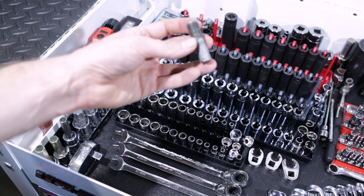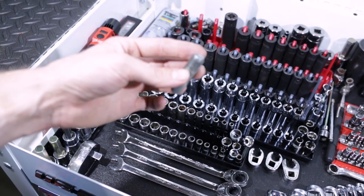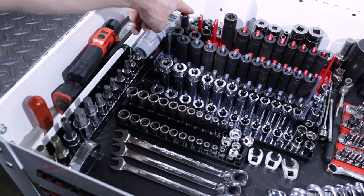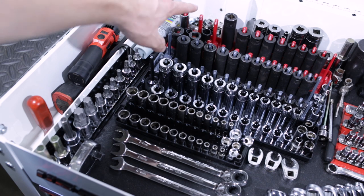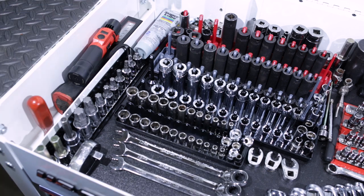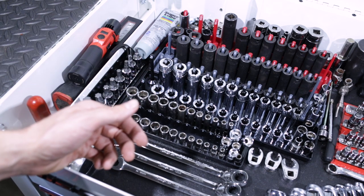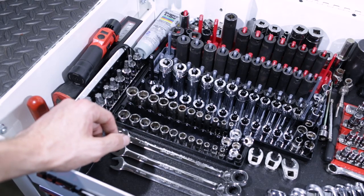Back here is a tool I made just the other day for installing wheels on a Mercedes Sprinter — just cut down a wheel bolt and put a slot in it so I can hang the wheels on it to install them. And at the back is my specially made Subaru AC compressor clutch puller tool that you've seen in the AC compressor clutch gap adjustment video. It's just three bolts to pull and one in the middle to press back on the clutch.